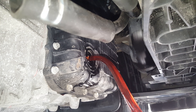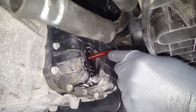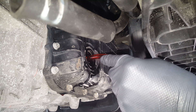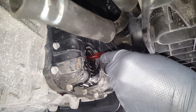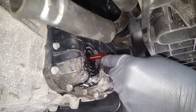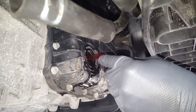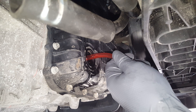Technically, you want to get it up to operating temperature, but if you run it about 10 to 15 minutes you should have it plenty good and warm. I drained out under three, three and a half quarts, so I know if I put back that amount it's going to be about right because that is what they will hold. We should see it start trickling — I don't have it up to temperature just yet. We got some drippage going on here, so you can tell it's seeping its way out, and we've put back in the exact amount — so it should be perfect.